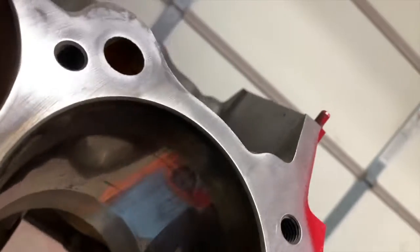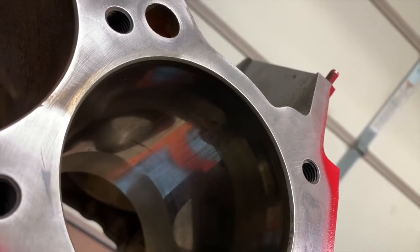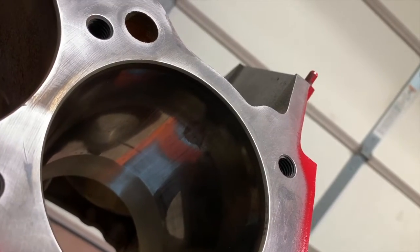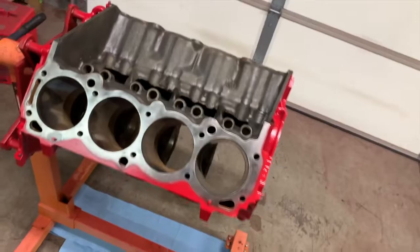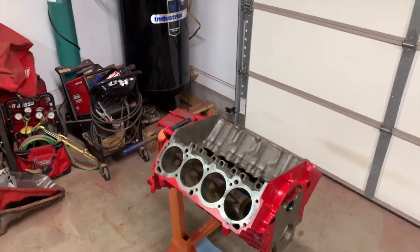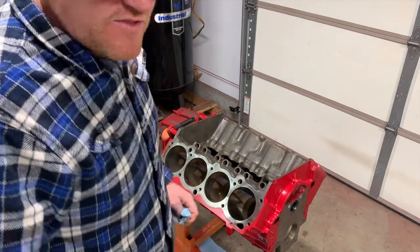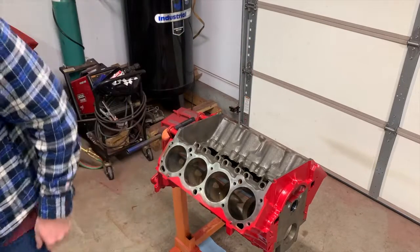In this engine, even though I call it a cream puff, I don't think it was maintained all that well. It did have a lot of, I believe, bad oil in it. Possibly they were running 1960s Pennzoil or some Quaker State that had a lot of paraffin in it, that caused the oil to not so much lubricate well, but it gummed up really bad. So now you have a basic idea of what the inside of the cylinder looks like.